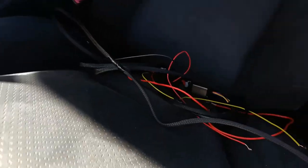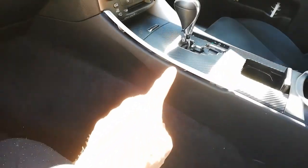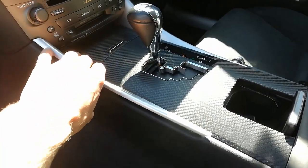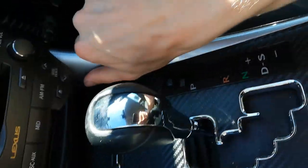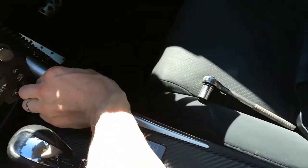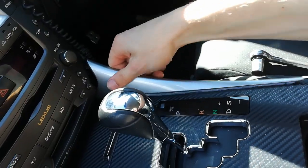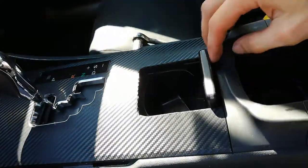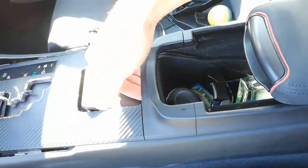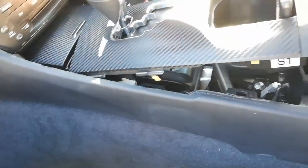To run the wires up from below and into the cabin, you have to remove the center console covers. Just pull this one out, and this one — back and up. They're clipped in so notice the clips: it comes back and up. You can then pull the whole console piece up. It's probably best to move the gear shifter knob back before you do this.